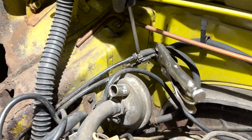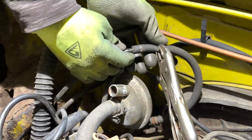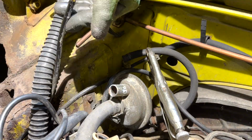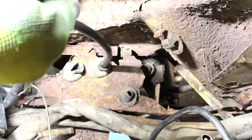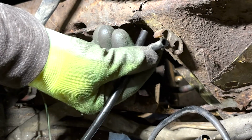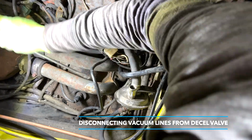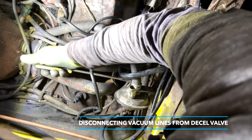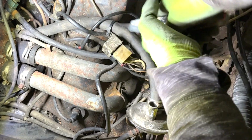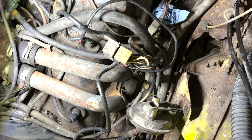On the other side of the engine where the fuel lines come into the engine bay from the firewall, I disconnected them where they join with the rubber hoses. They were very brittle, and I actually snapped one while I was trying to push it back down through the right engine shelf tin. Since the decel valve is actually mounted to the body in the engine bay, I just detached the large vacuum hose. Also, I doubt these relays were originally zip-tied like this.